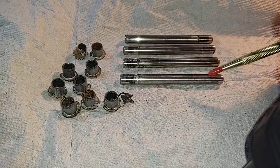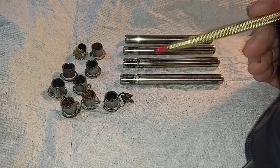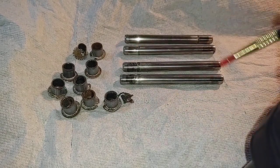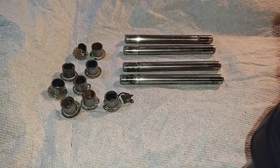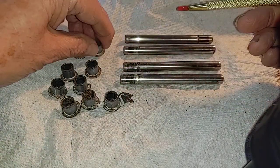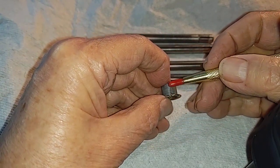The other option is to buy a new set of bushings. There's a gentleman who sells a set of — I think it's 18 bushings: 16 to do these rods and then two for the motor bushings. He sells them over on eBay. The set sells for $39.99, call it 40 bucks, and they ship apparently quite quickly from all the comments. That's the fast and dirty easy way. What he does say to do is take the bushing and before you try and put it in, come along with a cutoff wheel and a Dremel tool and do a slit right here.